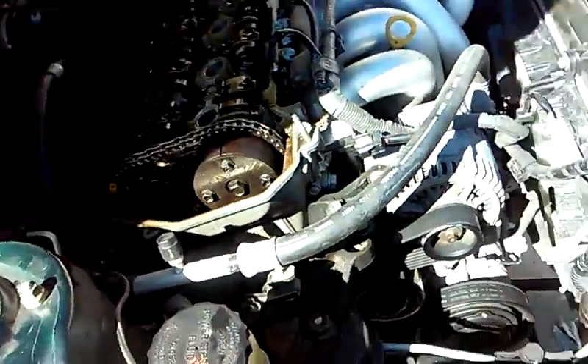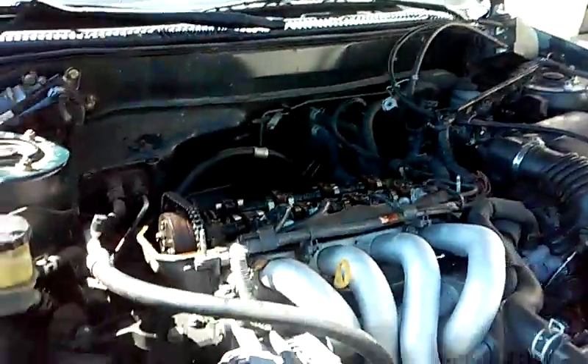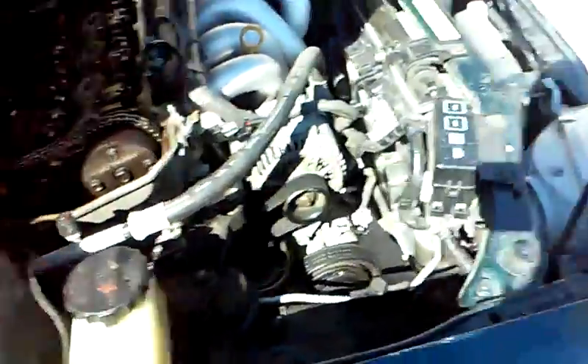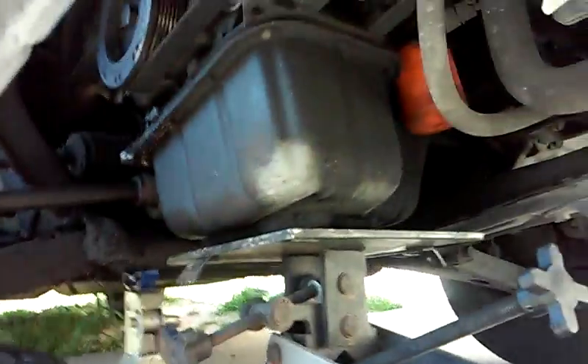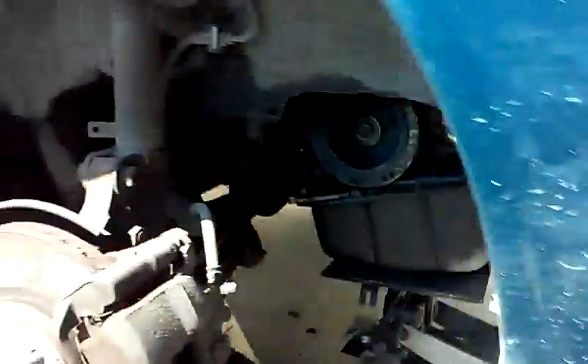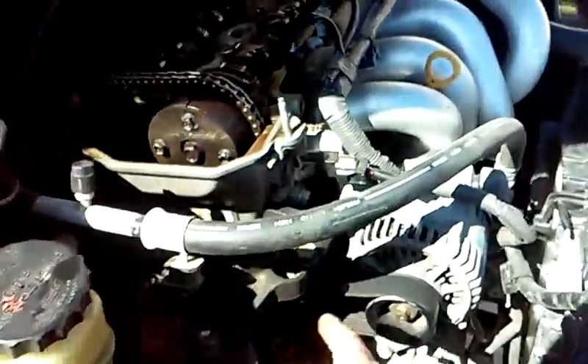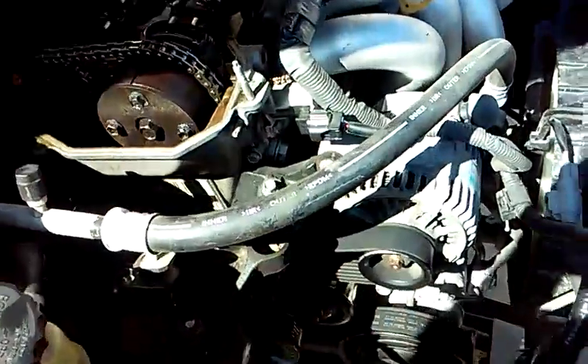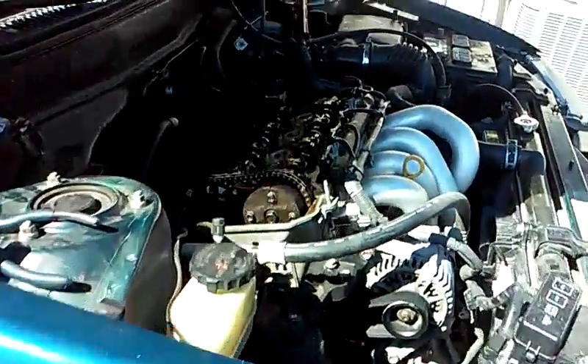My next step in this process is just to evaluate what I have going on already. I feel like we're now set up. I'm using a transmission jack because I like the flat platform on it and I don't have to worry about blocking with wood. I'm going to use my hydraulic transmission jack to support the engine just a little bit. I don't want to pick it up off the jack stand, because the next step is going to be to get this engine mount, stabilizer, and connector out of the way — and that's going to allow your engine to lean on you if you're not set up for it.